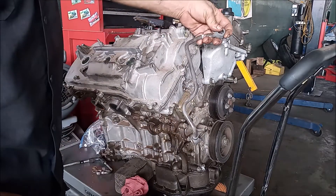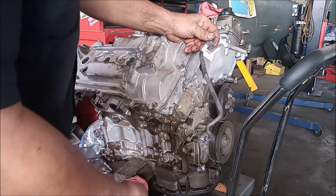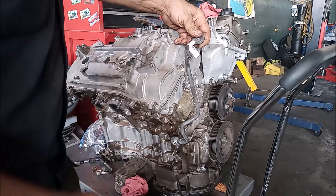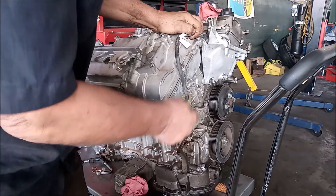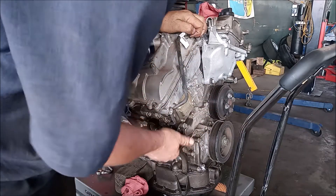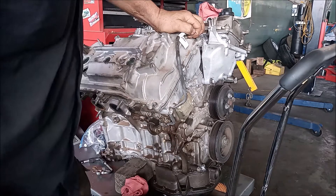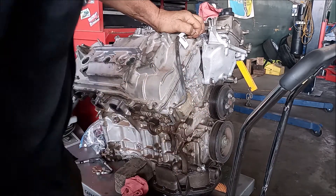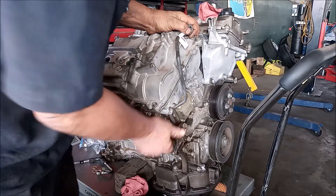This is one style of metal line that can be used for this replacement. This metal line is actually designed for the 2GR-FE with the TRD supercharger or for the Lotus Evora 2GR-FE, and it has a special shape that avoids the supercharger assembly and pulleys for the supercharger belt. In the description, I'm including the part numbers for the stock Toyota metal line — I just don't have one on hand, which is why I'm demonstrating using this TRD or Lotus line.